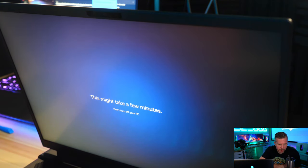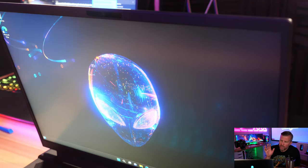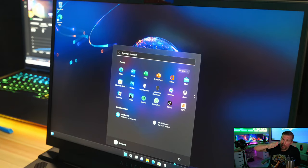All right, Daryl says, what's the difference between a PC and laptop graphics card? Good question, Daryl. This is something I talk about a lot on my channel and in my reviews. The laptop version of the RTX 4080 is not the same thing as the desktop 4080. It is significantly lower wattage, and in the case of the 4080 desktop and laptop, there are different CUDA cores, different total VRAM, and a different total wattage. All of those things can significantly impact performance. Now, an RTX 4090 laptop has the same CUDA cores as an RTX 4080 desktop. So an RTX 4090 laptop is the same as a 4080 desktop.